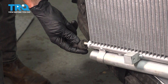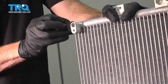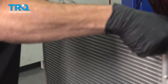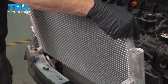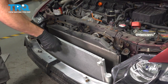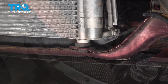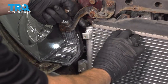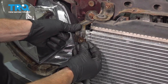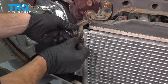Now we can install our rubber mounts along the bottom of that AC condenser — go ahead and slide it right on there. You can add a little bit of lubricant if you want. Now let's get ready to install that brand new AC condenser in the vehicle. Make sure that we slide the bottom into the proper ports on the body of the vehicle. Now let's align the AC condenser with the mounting brackets. Start the bolt in by hand and then make sure it's nice and snug.